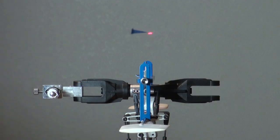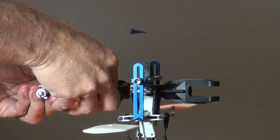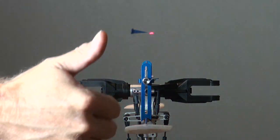It should be somewhere around zero pitch, but it doesn't have to be perfect. Now take the pitch gauge out of that grip, turn the head 180 degrees, put the pitch gauge in the other grip, and shine it toward that mark. If it doesn't line up with the mark, use your pitch links to adjust the angle of the blade grip until it does. Once you get it over the mark, verify by taking it out of that grip, turning the head 180, putting it back in the original grip, and making sure it still lines up, just to make sure the machine didn't get disturbed.